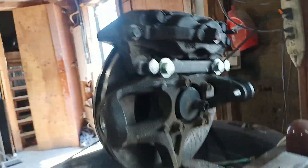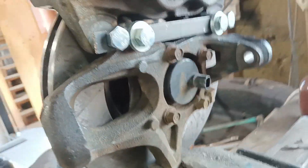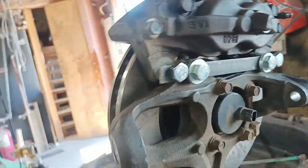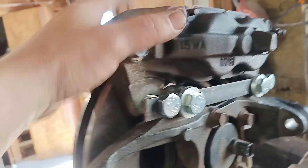We made our little practice piece — our bracket. It's just out of 1/8th steel by 1 inch. We're probably going to go with this 3/8ths material — just some steel. I'm sure aluminum would work in this, but the weight savings and the risk of things expanding at different rates when bolted — we're just going to avoid it. I'm sure it'd be fine, a lot of kits are, but I have that material so it's a free cost to me.